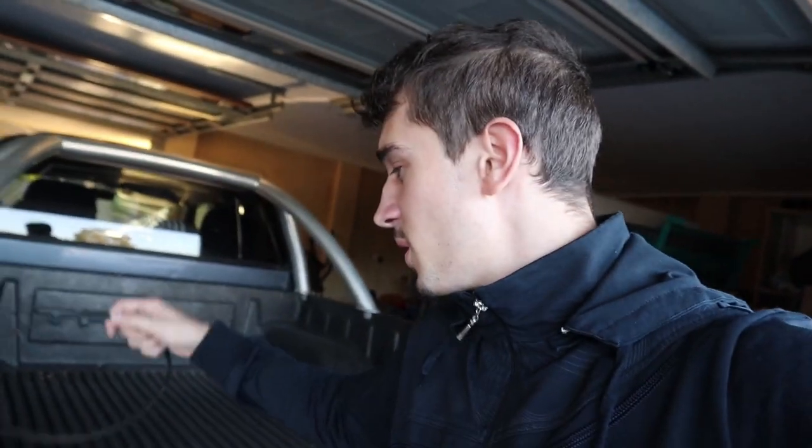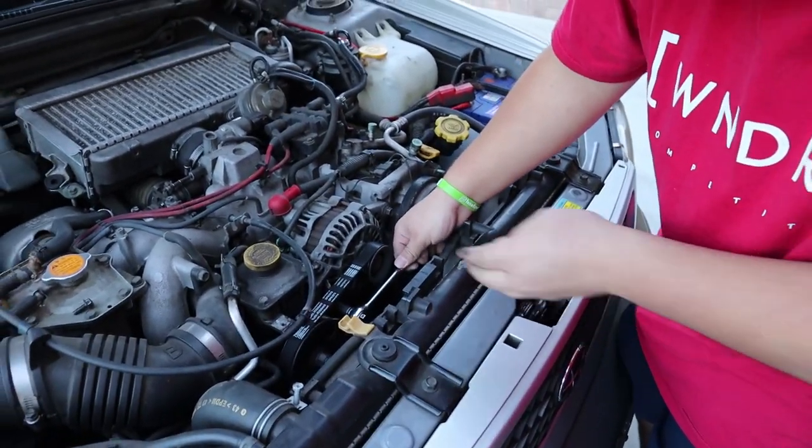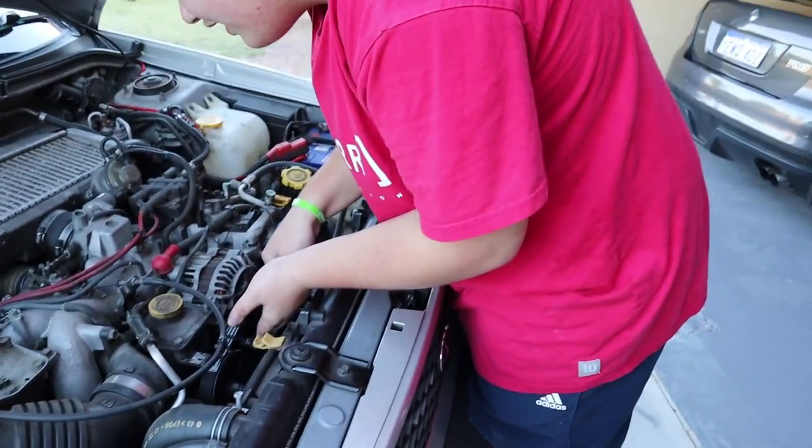The belts had actually caught on, but I'm pretty sure the whole time it was loose and slipping. Recently his power steering went off and his battery light came on the dash. The one we replaced was utter complete trash — slipping, loose, you could literally take it off with your finger. It wasn't charging the battery through the alternator, and it wasn't spinning the power steering, so that gave him no power steering. Literally cut the belt.